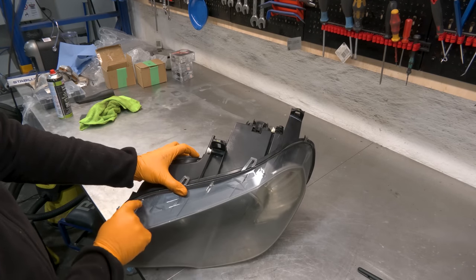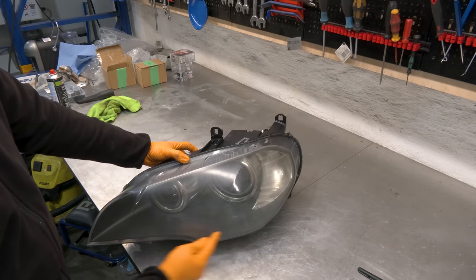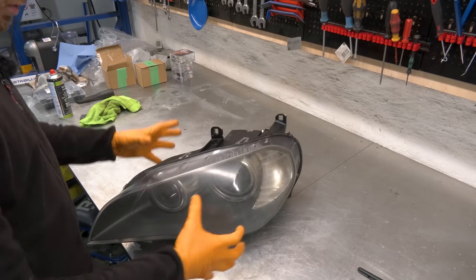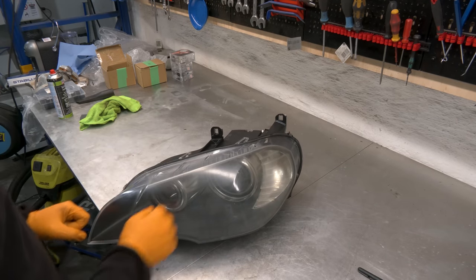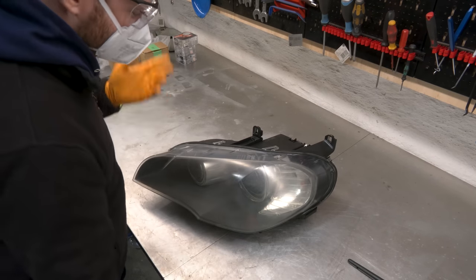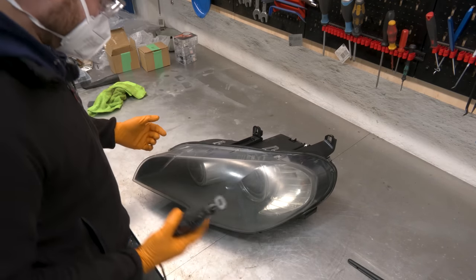There are screws here, here, and on the bottom that hold this inner trim piece to the cover. So just cut around it, and then once you disassemble the headlight, you can pull all of that easily and unscrew them from the back. Don't cut too deep either, otherwise you're gonna go through the plastic. Not that it matters, you can't see this once it's back on the car.